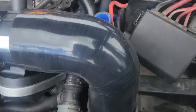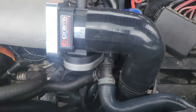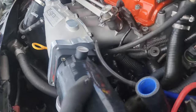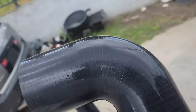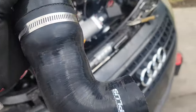All right, I got it in there. You can see the pipe kept its shape — I could probably still cut this a little shorter, but I'm going to leave it like this for now and trim it later if I need to. I cut it right at the end of the 90 on the other pipe. Everything lines up and it looks good. The 2.75-inch coupler was big for this particular pipe — I watched another video where somebody used 80 to 70mm which is 3-inch to 2.75-inch — you can see it really stretched it out and it was hard to get in there.